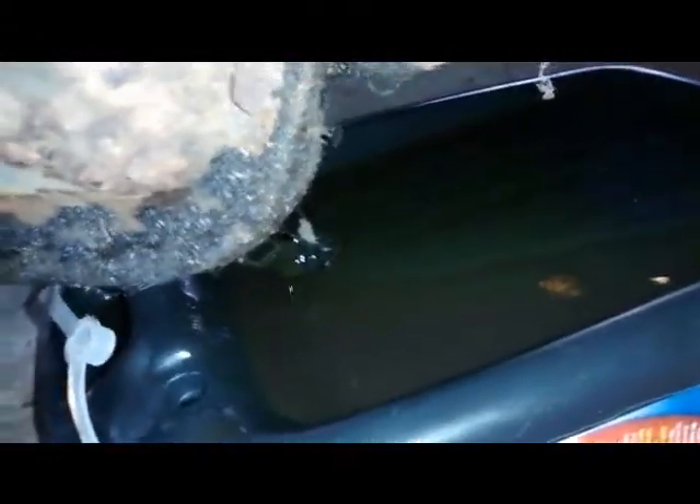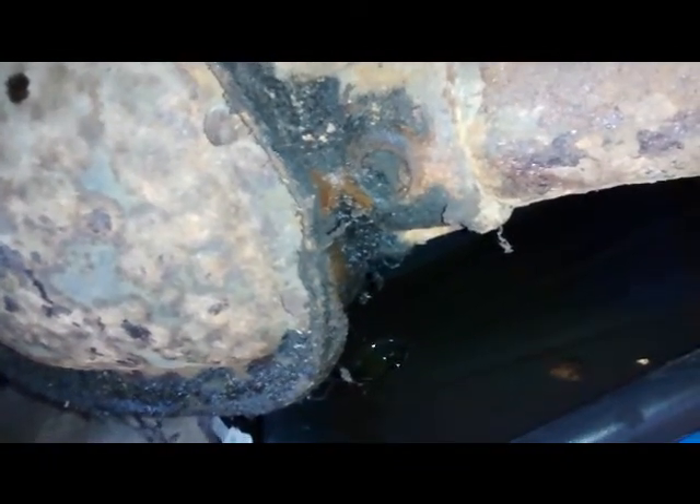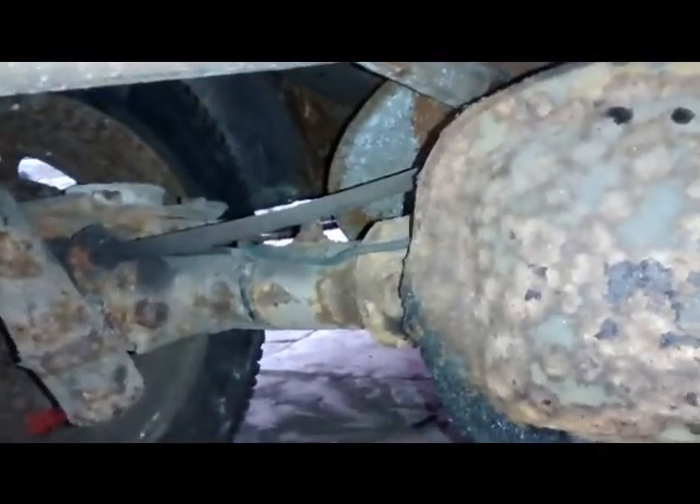Once that's finished, I'm going to seal it back up after cleaning the sump plug, then I'm going to remove this. After that, I will put 1.2 litres of the correct type of oil, which I'll discuss later. And the fill plug — I'll also check that the breather is not burned up.